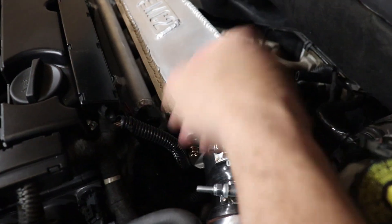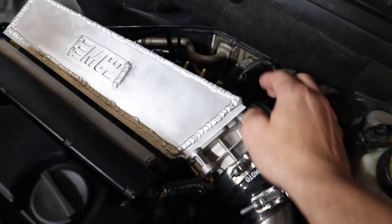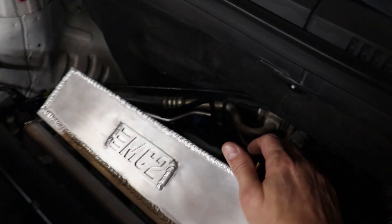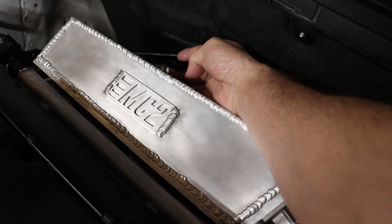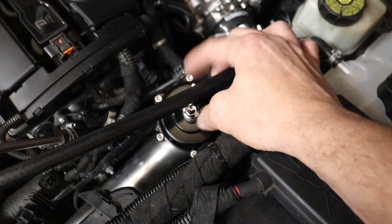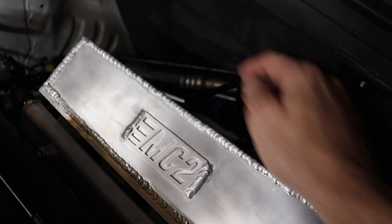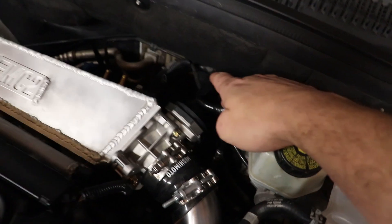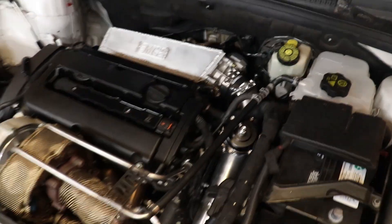I got this wiring taken care of — we have our MAP sensor plugged in and our throttle body all plugged up. Some of the other things I need to do: I need to connect my brake booster, and we also have this evaporative emissions valve here, which basically pulls gases from the gas tank into the intake to be burnt for emissions. I've got to figure out a way to tee this in with the blow-off valve so it gets boost or vacuum, and I'll probably need to install a check valve for the EVAP stuff so we don't boost the EVAP canister. The brake line does have a check valve built into it, so that's fine.